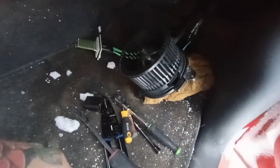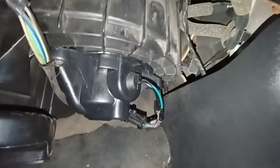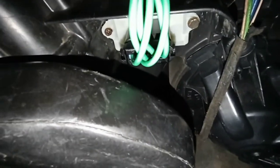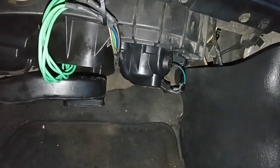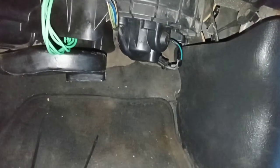I'm gonna finish shrink wrapping, heat that up, and put the resistor back in its place. I managed to find a couple more 8mm screws, so I got all three in the blower motor. I zip-tied the new loom, and found one more screw — a wood screw — and I was like, screw it, that'll work. Now this all works 100% like it should: blows hot air, no noises, everything is secure. Fingers crossed there shouldn't be any more issues.